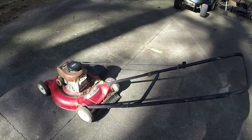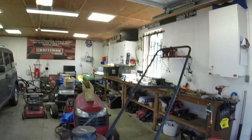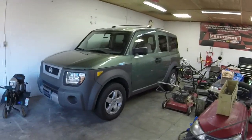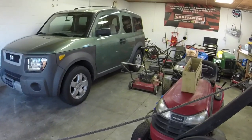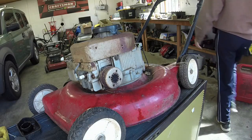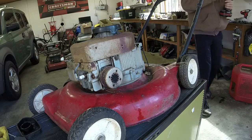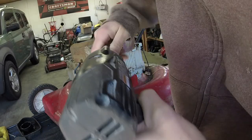So we don't have much left to do. I figured I'd go ahead and take you on the journey of replacing the pull rope as well, since we're doing pretty good time-wise on this video. So 7/16ths just loosens this up and you just pull your rope out. The good news is this one was about borderline as to whether or not I wanted to replace it, because like I said it's a $50 mower. But it saves me having somebody come back and say my pull rope broke. Let me grab my impact and a 3/8ths and we'll just take the bolts off and take it over to the bench.